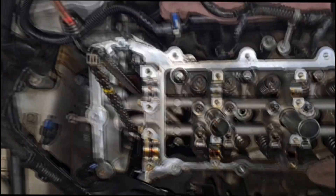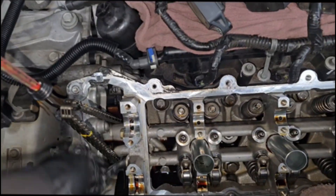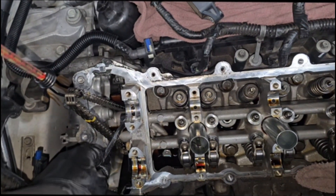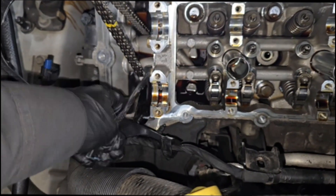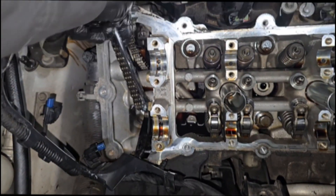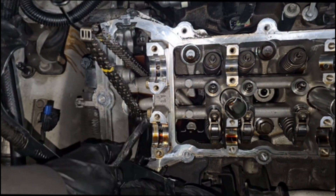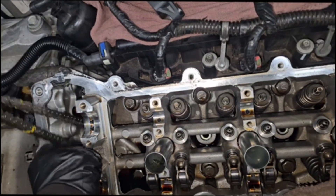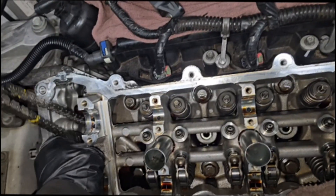See if they're loose - oh my goodness, that was tight! This means the other one was loose. We're gonna take those off, put Loctite on them, and torque them down to spec. They have a habit of working their way loose. When they work their way loose, the engine will lose oil pressure. When you lose oil pressure on a variable valve timing engine, that spells bad news.